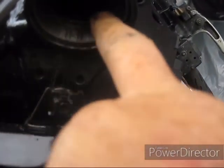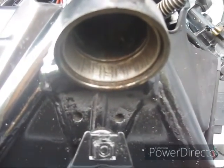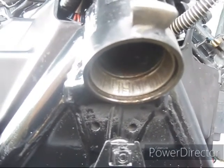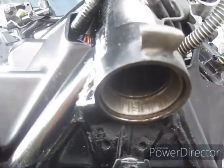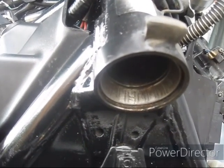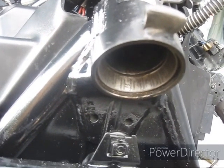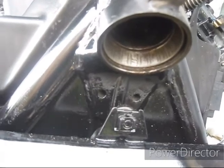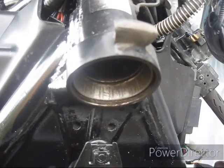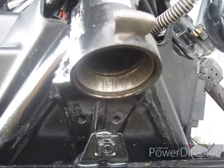Nah, it's no good. I can feel with my finger. These things have enough trouble with high-speed wobbles and so forth, and it's critical to have the front end set right. So I know I'm gonna have to replace this. Anyway, I'm just gonna stick the other front end up in here and make sure that the bearings and everything are the same — I think they are, but we'll find out here in a minute.